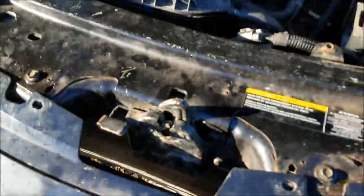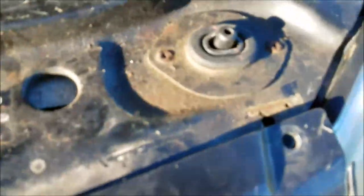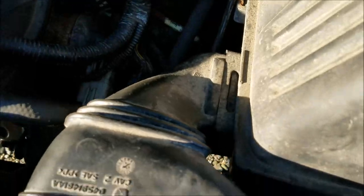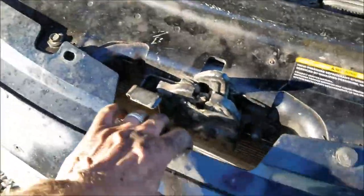Secured those — they're 13s. Got the little push pins in. Got the small bolts that hold your hood latch assembly — make sure you line your washers up with the original marks on there, because otherwise you'll end up having to re-adjust the latch. Get the push pins back in, don't forget to get the air cleaner back on, and the push pin assembly back in place. Looks like we're good.